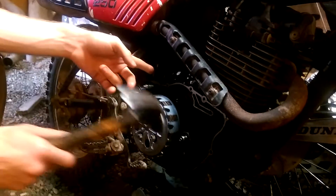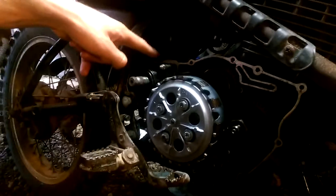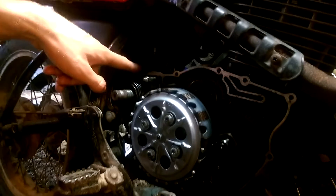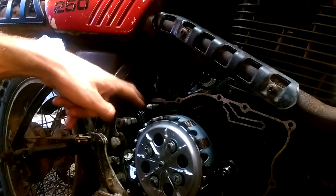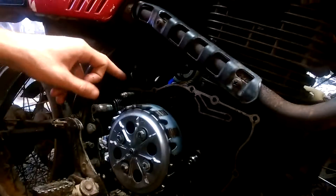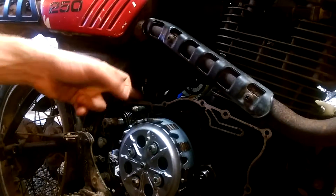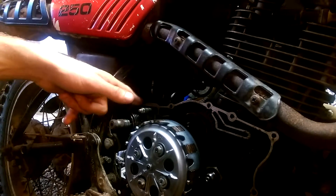If your bike has had the modification done to it, on the serial number on top of your engine here there will be a punch made in the center of the numbers. There's a dash in the middle of the serial number on here, and once this is done you're supposed to go and punch that dash — put a little punch mark into that.